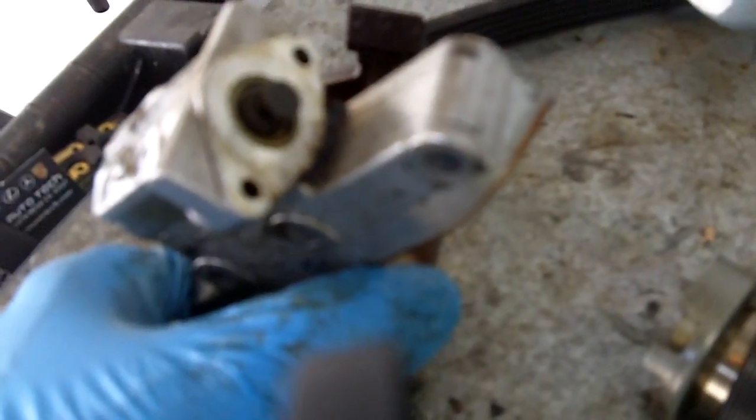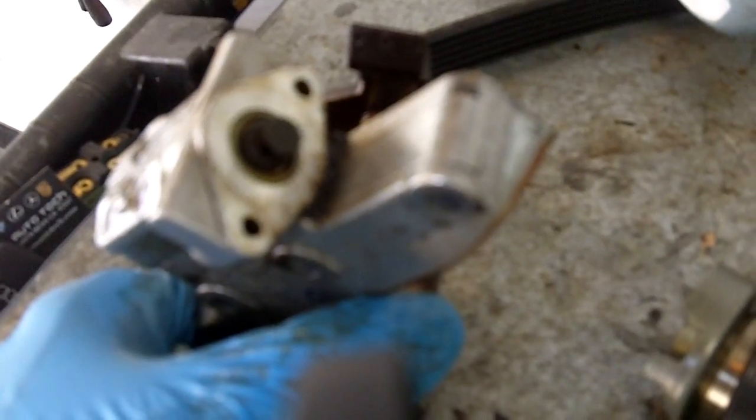This is an easy fix. If you get a code and it's only the solenoid that's bad, you can do it on the car — it's probably a 15-minute swap. The only bit of bad news is they don't go bad that often, and you can't get them separately, so you've got to buy another tensioner. I had that code and tried it. I think the tensioner actually caused the solenoid to go bad. I bought a whole new tensioner, just replaced the solenoid, was sure it was going to be fixed, and it wasn't. I wound up doing the whole thing.